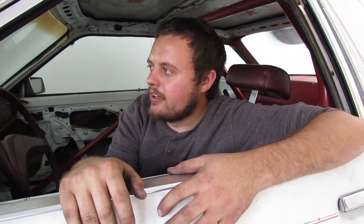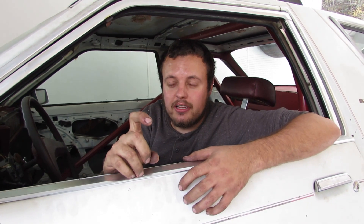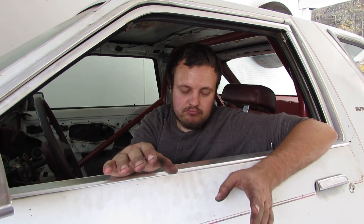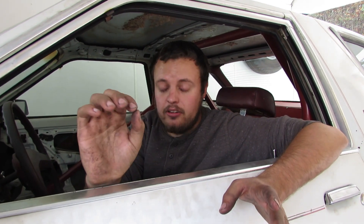So on that last pass, the diaphragm in the wastegate failed. We thought maybe the three-port boost controller failed, but what actually happened is the air was leaking past the diaphragm to the other side of the three-port and right out. It's probably pretty screwed up in there. But we're going to call that good — 441 horsepower on 16 pounds of boost. Fuel looked good, spark seemed good. We're going to run it. We'll see you guys in the next one.